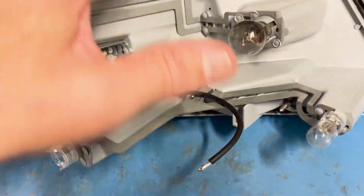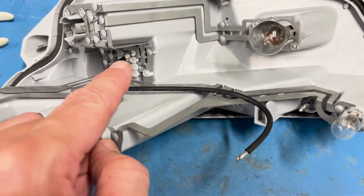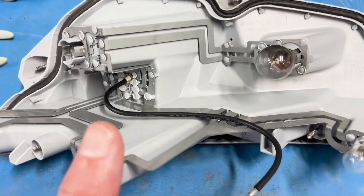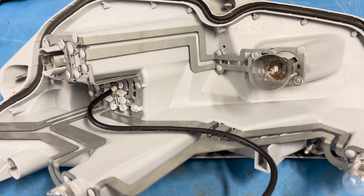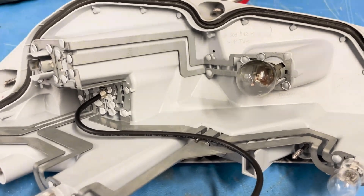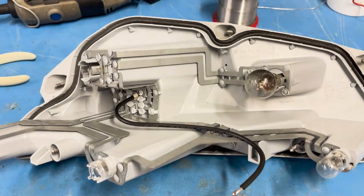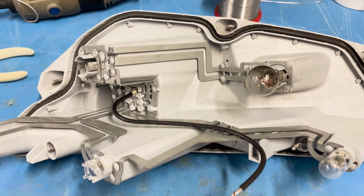That sort of fixes the light fitting reasonably well, but the problem is the other side of the connector — the plug on the wiring harness — is also burnt. In the short term I'm just planning to clean the contacts so at least this works, but I think I'm going to replace the crimp terminal. You can buy them online, and if I can find a part number I'll leave the link in the description. You can buy a replacement crimp, cut the old one off, and fit the new one. It's not going to be a permanent solution — it still runs the risk of burning again — but at least it'll look a bit tidier.